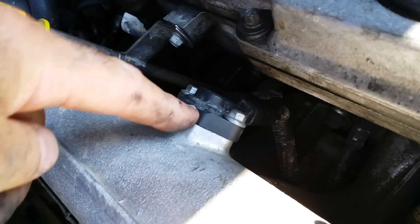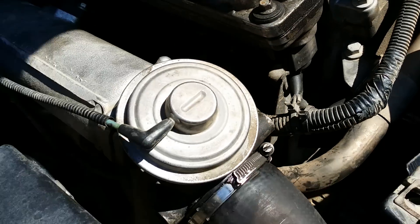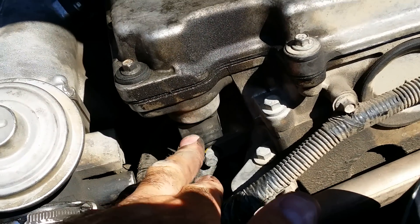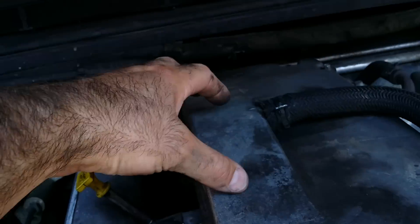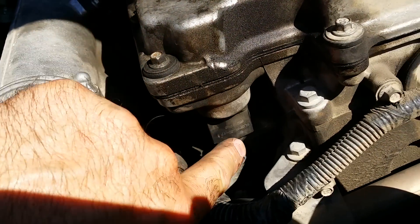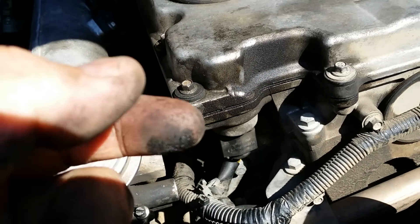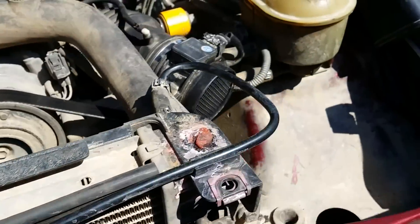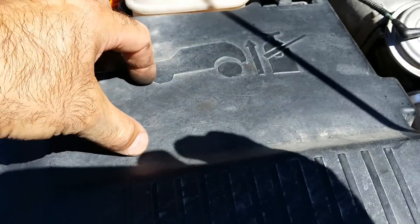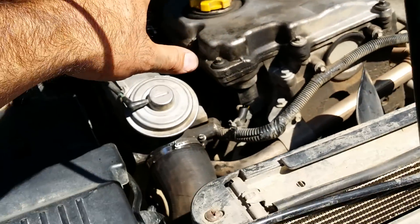Your MAP sensor can have problems — this one was a bit gunked up but wasn't the main problem; I cleaned it all out. Most commonly of all, there's a little wire plug that comes out of the wiring loom — that is your injector plug, because the injectors are all sat in the top here. You've got to get the cover off; they can leak. Take that plug off — it's only two clips either side — put your finger up inside it, and if you've got oil on your hands you've got to change the loom that's inside there. The oil can get back to your airflow meter, and also under the cover near your battery there's your ECU — take that out and make sure there's no oil in there. If there is, you've got to clean it out. The injector loom had been done, but that wasn't the problem.